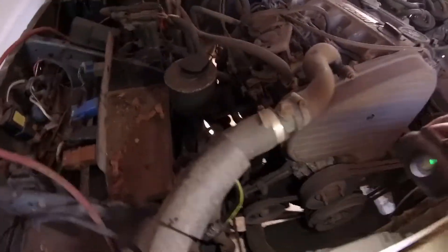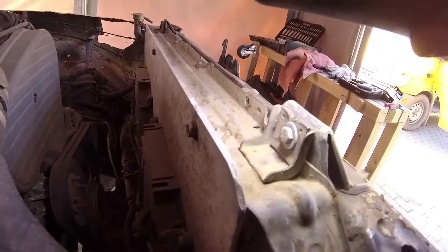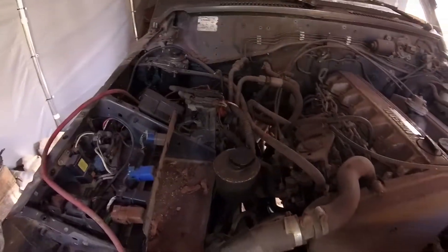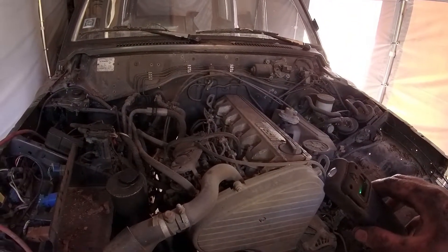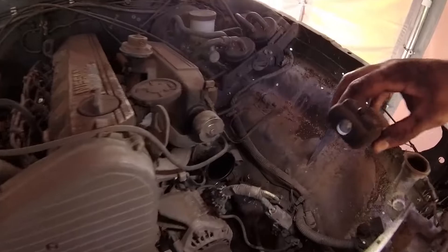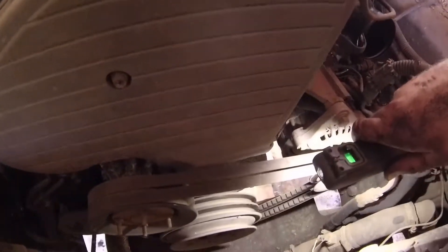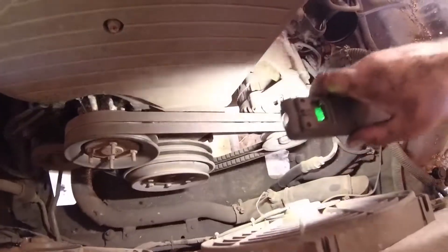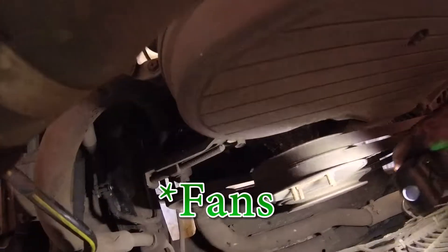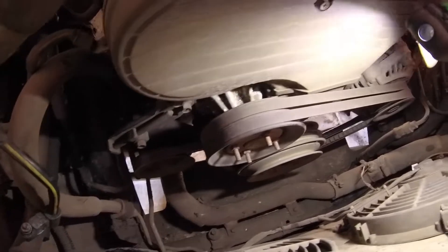So the radiator itself — it's held in by 10mm screws, one here and one here, and then it just clips into place downwards. I want to remove the coolant tubing — actually I don't want to remove it from the engine just in case anything gets in there, I'm gonna remove it here in the middle and way over there down there, just so I can keep the thermal sensor that controls the radiator. There's wiring going everywhere and I don't remember how to remove it.